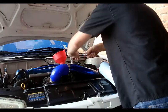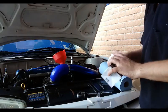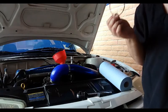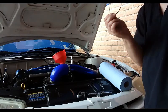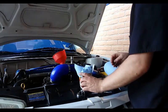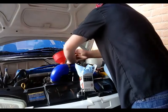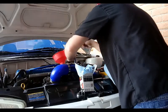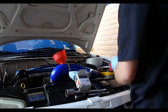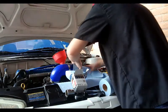This is why you need that extension to reach it. When you change the oil filter, you want to make sure you also change the little rubber seal and that it's seated properly, or you'll have an oil leak. These seals go bad and dry rot over time, so do replace them — they usually come with most premium filters. Make sure you get a premium filter that includes the seal. Take a paper towel and stuff it under the housing, then loosen it up with the socket.